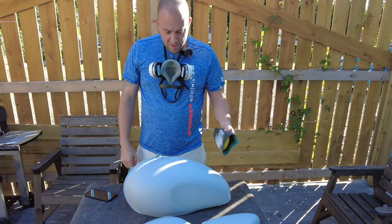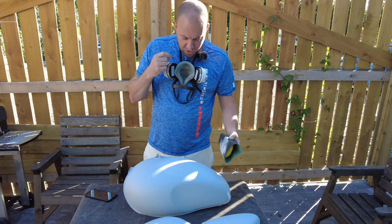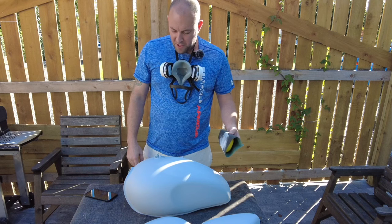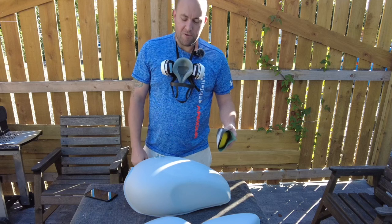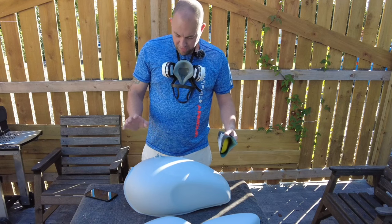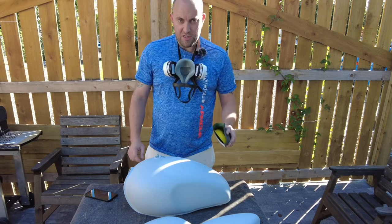Just the following day - I managed to get about three coats of primer on last night. Finish is not too bad. The first can I opened up, there were a few drips that came out whilst I was spraying. Turned out that when I took the nozzle off and looked, the nozzle was cracked underneath it. Tip for the future - always check the nozzle's on the tank before you start. But overall the finish is pretty good, a little bit rough, so I'm just going over it with some 400 grit to smooth everything out, and then I'll see what the general coverage is afterwards.